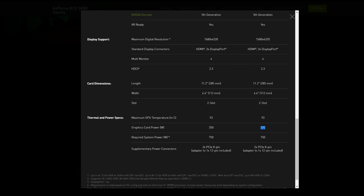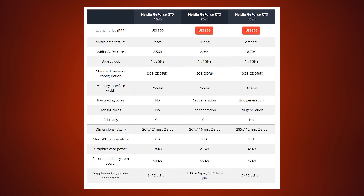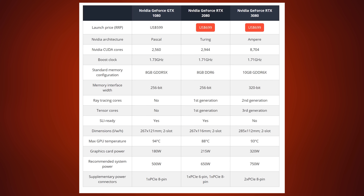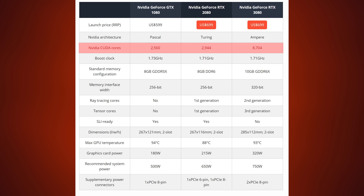You may be asking why this is, especially since the efficiency of the cards — that is the FPS per watt — has improved. Well, as AMD and NVIDIA compete for the top spot for graphics performance, they do so at the cost of adding more stream processors on their cards. So even though the cards become more efficient, they add more power draw in total. Because overall, the stream processors they have added produce more power draw than the efficiency gains from architecture and node shrink can take away, leaving consumers with more overall power draw. So many PSU manufacturers in the past would not have envisioned this when producing 650, 750, and 850 watt power supplies, since they thought GPU TDP requirements would not balloon as fast as they have to the levels we're seeing with new graphics cards.